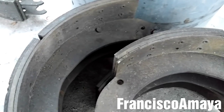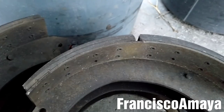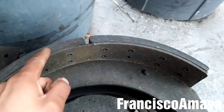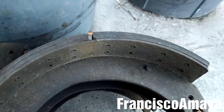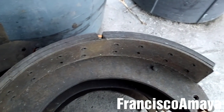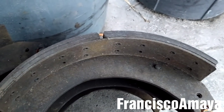Remember to pay attention to your brakes because this is a very important area of the truck, especially for DOT inspections. Now, another point you have to look for on your brakes is cracks. If you see any crack around the lining of the brakes, you need to replace those brakes, because DOT officers are always looking for cracks, and even a small crack will get the truck pulled out of service and cost a lot of money.